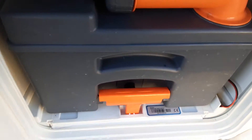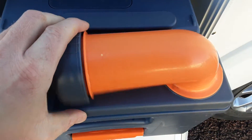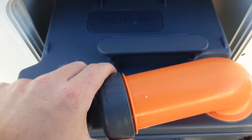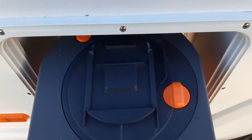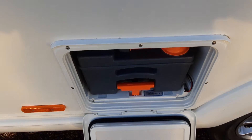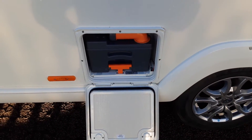At the bottom you have your toilet waste cassette. It releases by pulling up the orange handle and pulling the cassette towards you. The neck turns out so you can tip the waste away when the cassette is full. The grey cap is a measure for your pink and blue fluid. On the back of the cassette there's an orange pressure relief button so when you're tipping the waste it doesn't spit back at you. Put one litre of water and a capful of blue fluid in here prior to use.